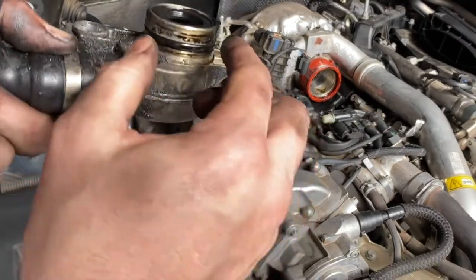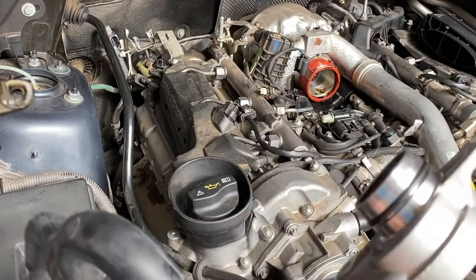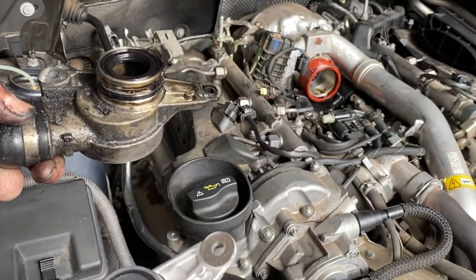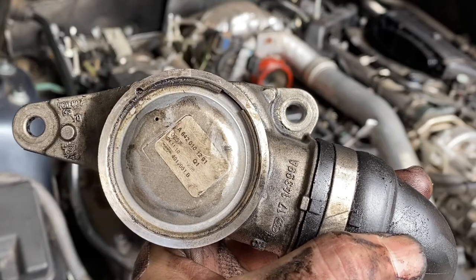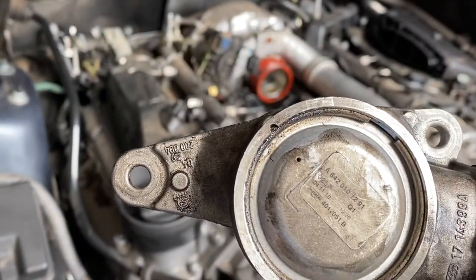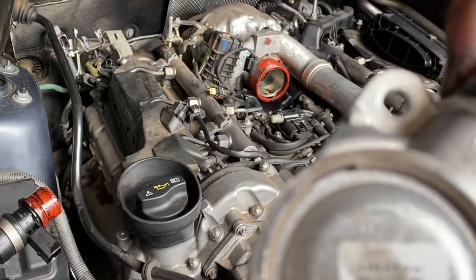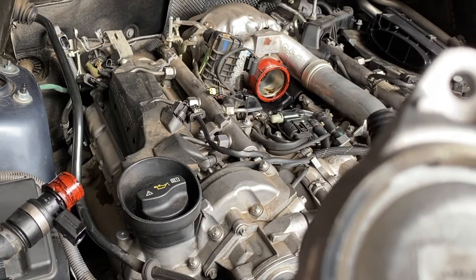You can see it's all oily and that O-ring is really flattened out, whereas on the new one it's a nice round O-ring. This whole thing was actually beginning to leak crankcase oil and vapor at the back of the engine. Just a slight compare of part numbers: the old one is A6420101291, manufacture date 2010 - it is the original that came on the car, never been replaced. The new one is an updated part number A6420101791, manufacture date 23rd November 2020.